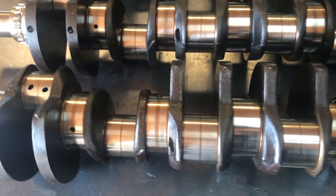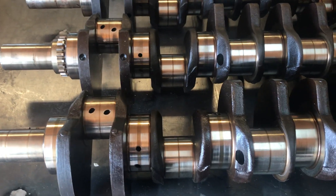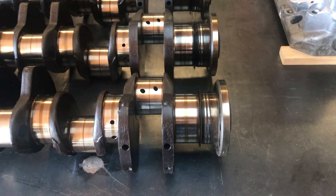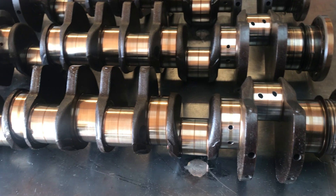The other two aren't junk. What I'm going to do is have those ground ten-thousandths undersize — I've already got ten-thousandths undersized bearings for them. We will be offering those for sale on the Jaguar Preserve website sometime before the end of the year, for those of you who wish to rebuild your own engines.